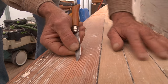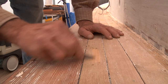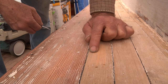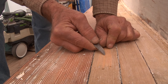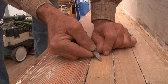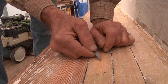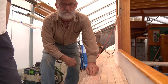Then getting into the deck itself, you can see the nature of this wood is so much different. This wood is fairly consistent all the way across — you can see the hard grain line, but it's very, very narrow, and the softer line is wider and not even as soft as the soft grain lines in the fir. This is much easier to compress in the softer grain line than the fir. This is some sort of spruce, and that is Douglas fir.